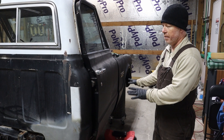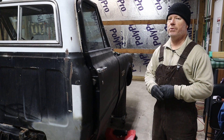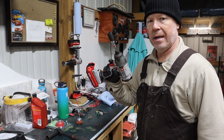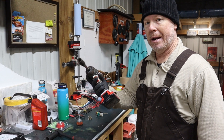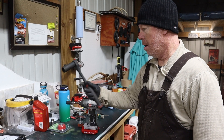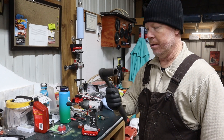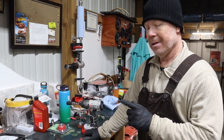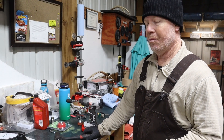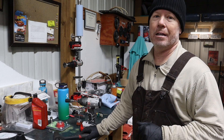I've already taken care of that on the passenger side. We're going to work on the driver's side and do that complete. For tools: on the rear you'll need a 5/8-inch socket — I was able to take mine off with an impact, though you may not be able to. On the front bolts you'll need a 7/8 deep-well socket. Also have a breaker bar on hand; I needed one to break the first bolt loose, partly because a previous owner had painted over the bolts and nut.